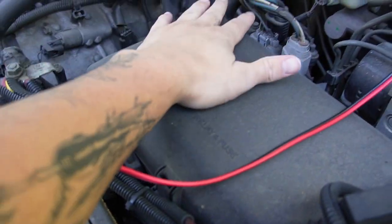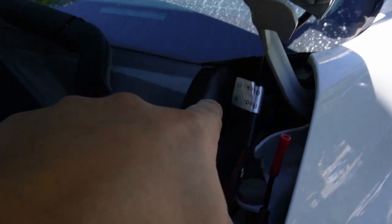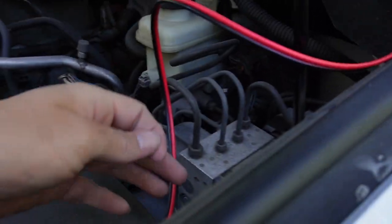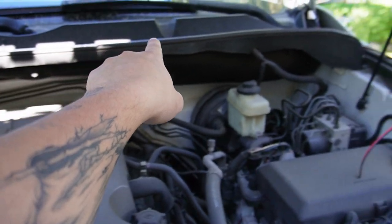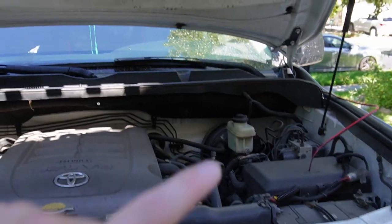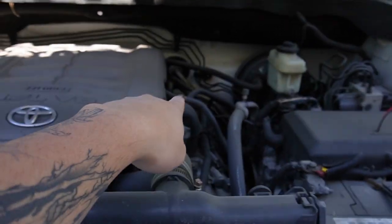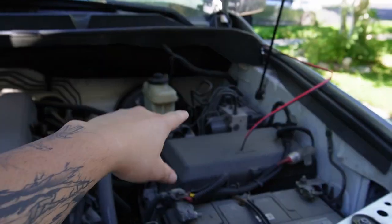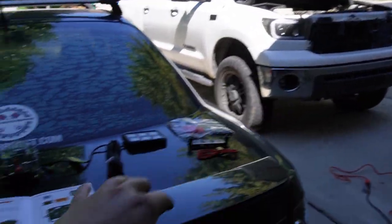The pod light is mounted on the hood, comes down underneath, connects to our wire harness, runs through this little gap, and straight into the motherboard area — which I'm thinking will go on top of the fuse box. I went ahead and did the other side as well, running it alongside and down to the panel. Next we'll have to go inside the truck and mount the panel, possibly running wires through the firewall.